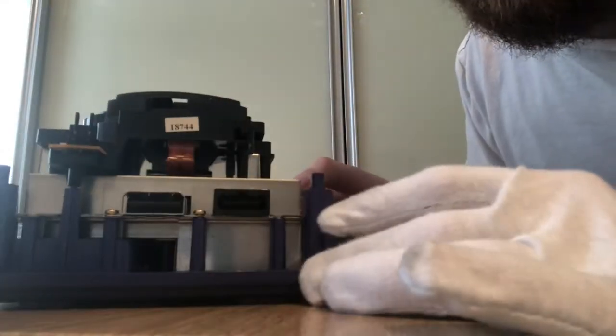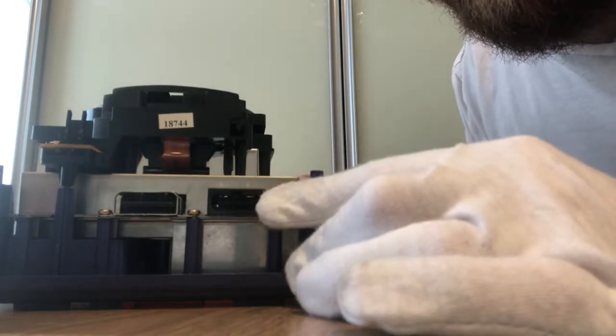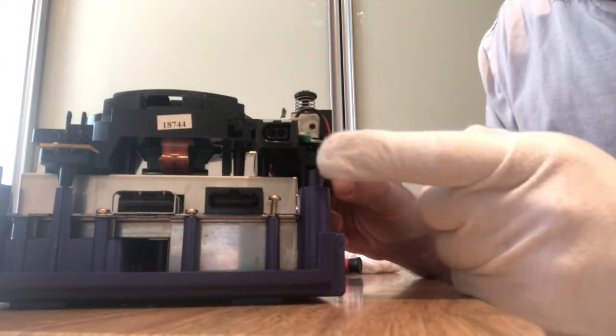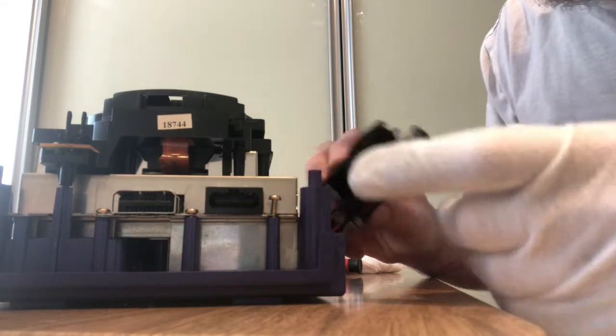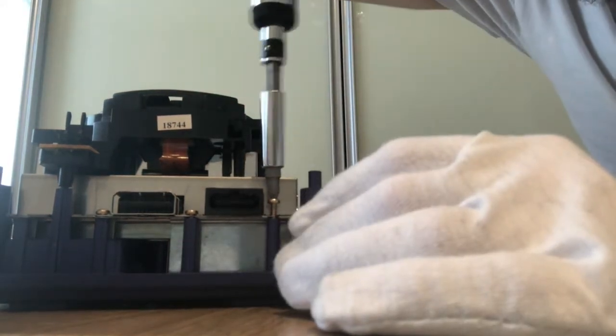There is another screw that needs to go in before you put the fan housing on, and it's just to the right of the AV output here. You need to make sure that you put that one in before putting the fan housing on, because the power input will block that screw housing. So you need to do that one before you put the fan on.